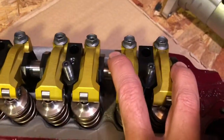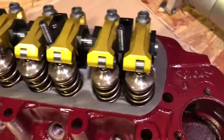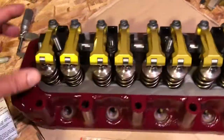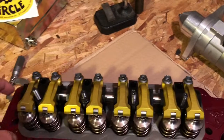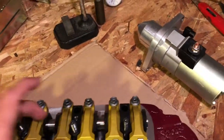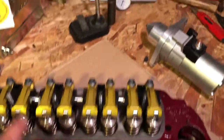These are unique in that they have a cradle that supports each pair of rockers. One thing very different about them is there are no cotter pins or washers or anything on the ends. Once you locate these on the studs, that's it. Lovely bits. This is a solid shaft style to do away with the often troublesome roller fulcrums, where you introduce way too much oil. This is a more stable setup. Improved metallurgy allows manufacturing these pieces right off.